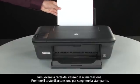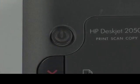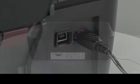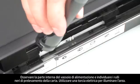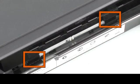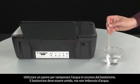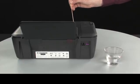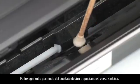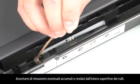Remove the paper from the input tray. Press the power button to turn off the printer. Turn to the back of the printer and disconnect the power cord. Look down through the open input tray and find the black paper pick rollers. Use a flashlight to illuminate the area. Clean the rollers with a clean cotton swab lightly moistened with water. Use a cloth to blot excess water from the swab — it should be damp but not soaking wet. Wipe each roller starting on the right side and wiping to the left. Use the swab to turn the rollers as you finish cleaning each section. Make sure to remove any buildup or debris from the entire surface of the rollers.